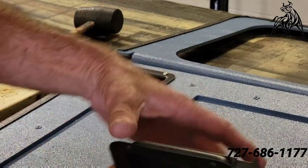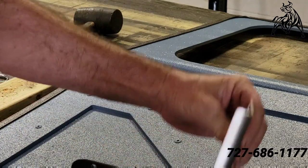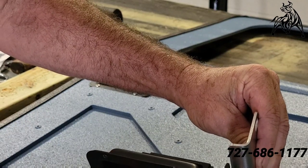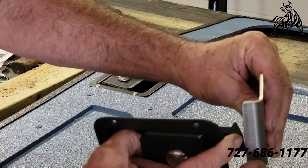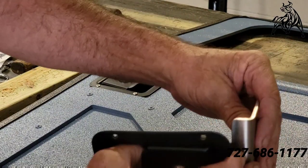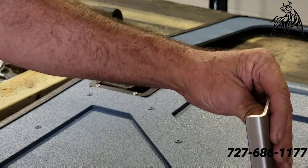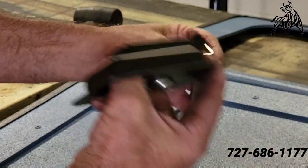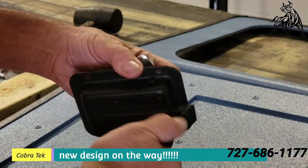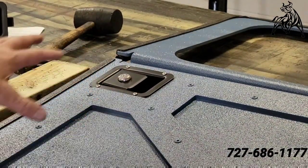What I'm talking about here: you have your latch and a spring-loaded device which moves back and forth when you pull the latch. This is mounted to your truck — the latch can't just hit the striker face-on. It has to hit right on that angle so it pushes it in and allows the latch to bypass, go past the striker, and then spring out on the other side, capturing it. This is slotted, and there's a fine line between wrong and right. But when you get it dialed in just right, that door will shut perfectly — the tension will hold it nice and tight with the rubber gasket all the way around. You also get a pull cable to open it when sitting in the seat.